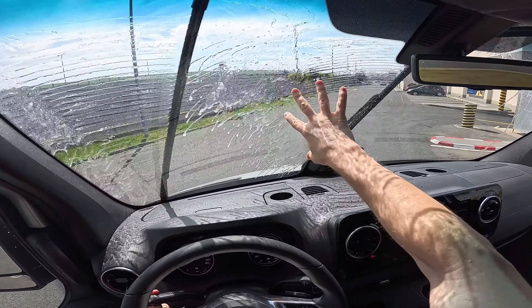You have three battery options: 58, 81, and 113 kWh. The version I have is the 81 kWh, giving up to 324 km range, or around 255 km in mixed mode. Right now the screen shows 276 km remaining with 90% battery. Depending on use of the climate system and load in the back, minimum range is around 155 km, but maximum could reach 284 km with a light load and minimal climate use.